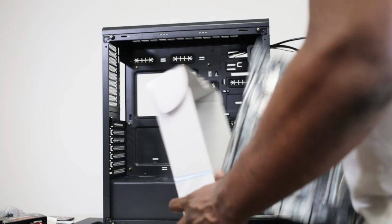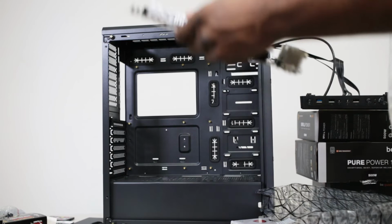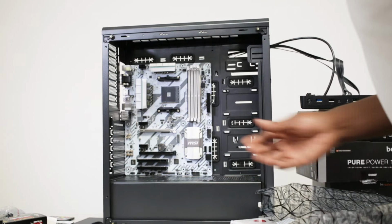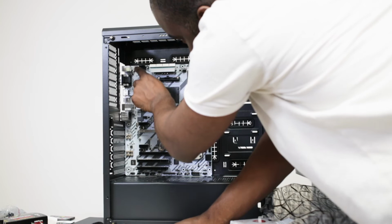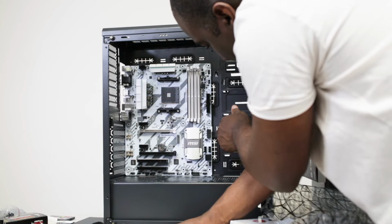Right, so if I just grab this out quickly, I'm going to check what it looks like. So that's what a motherboard will look like in here. So that's perfect. Near enough, just a millimeter up, and then it lines up with the screws. But you can see where the EPS connector is, so you can have the radiator at the top, and then you can have the EPS connector, and it comes through here and into the 8-pin at the top there. All your fan connectors and stuff, pass throughs. Yeah, it's pretty awesome. The 24-pin and the USB 3 will be all right.